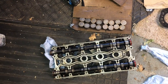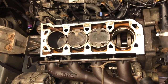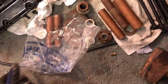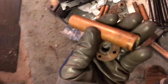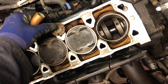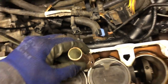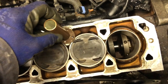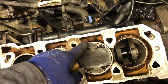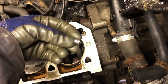Cleaning tappets is a bit time-consuming but should remove any tapping noises if done properly. If for any reason you want to rotate the engine, make sure you use liner clamps, which you can make up yourself. I've made a few here using copper pipe and various washers from the garage. These are 99mm long roughly. With the right size washer, you can have it just over the liners, then put the original cylinder head bolt with washer through there down into the oil rail ladder at the bottom. That will hold the liners in place because these liners are a slide fit and there's always a possibility they will move when the pistons are moving.